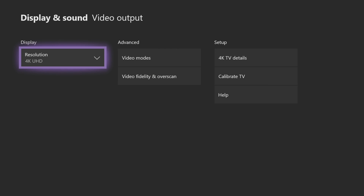It does not have any support for PC formats, so if you're at 1440p, it does not seem to work whatsoever, and that also includes anything over 60Hz — so 1080p 120, 1080p 144, 1080p 240, doesn't matter. 1440p or anything in between 1080p and 4K are probably not going to work. That's a little disappointing, and we'll talk about another capture card that does that in a moment.